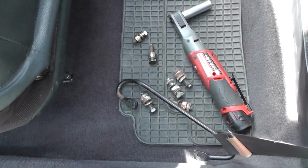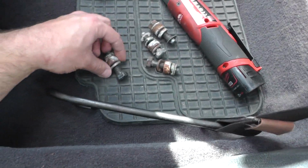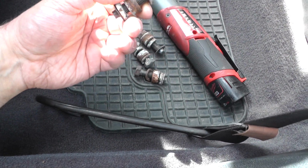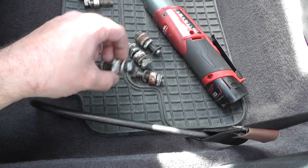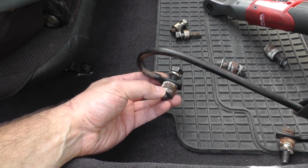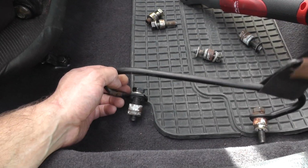So notice I didn't actually have the correct number of washers in here. So before I just had these in here, and this is like the full complement of washers. So important to have them all in there. And yeah, I'll show you what it looks like. If I'm completely wrong, but I think it goes this little plastic thing that holds the whole bolt together, thin washer, thicker washer, the bar itself, and the split washer here, followed by the bolt on both sides.